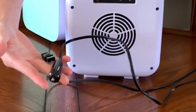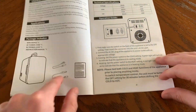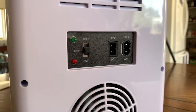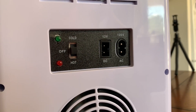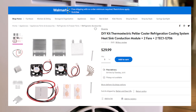This fridge is dual power, and it's slightly more efficient while running in your vehicle. The household 120-volt input loses some efficiency, as it has to be internally stepped down to 12 volts DC. You'll also notice that this is a dual-function cooler and heater. This is a thermoelectric Peltier fridge, not a compressor fridge, and we'll go over the pros and cons of this later in the video.